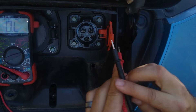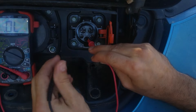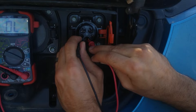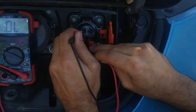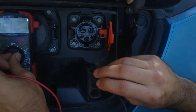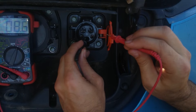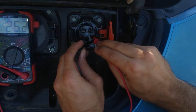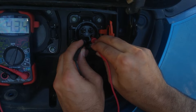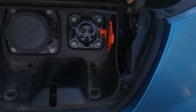This way is infinite. Let's try it — this should be forward biased. Let's try it in diode mode. If this is forward bias, it should be 13 kilohms. It says voltage, so back to resistance. The fact that it's infinite makes me think that there's an open. On the voltage check, DC voltage, there should be 4.5 volts approximately between these two pins. Ground is at the bottom, and this is the proximity pin. Reading is 4.34 — perfect. So that proximity is working. The pilot is not working. Looks like it's some sort of an open.